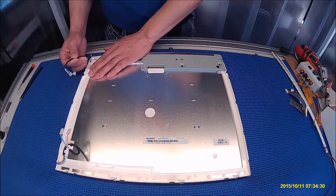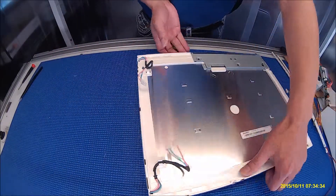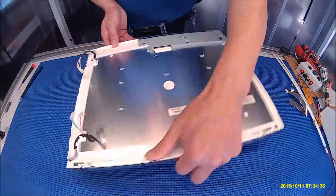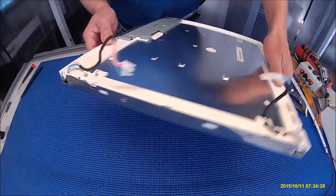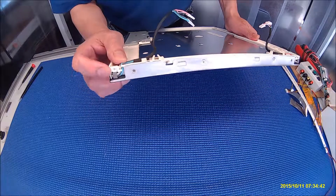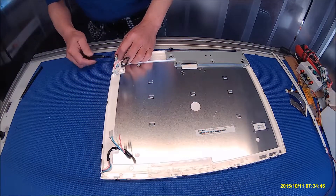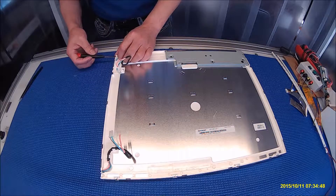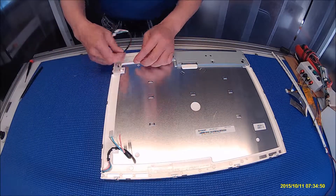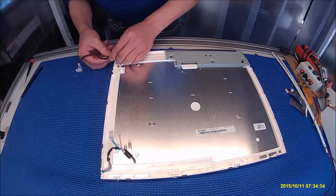It's a really nice screen. In order to remove the backlight, it's quite simple. There are two ways to do it — I'll show you later. You can see there are screws here, one, two. So what we need to do is just remove these small screws here, and then basically you just pull out.